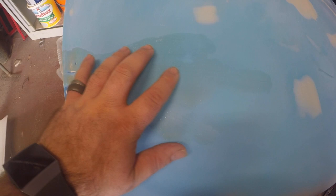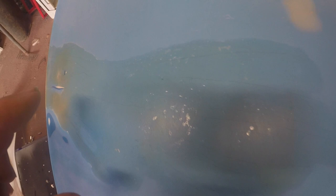Next thing, once the boot has dried, is to turn it over, prep the outside and start painting that in primer. Also flip the bonnet back over, do the final bits of prep and get that into primer too. In terms of work still needed on the bonnet — in this area where I put the fiberglass resin to seep into these cracks, it's reinforced on the underside, but I wanted to put some on here to stop them threading. It still just needs some more finishing there, and this section is still lipped, so that needs more attention.